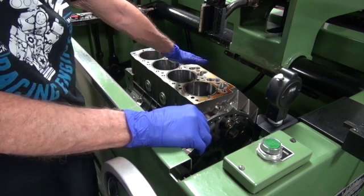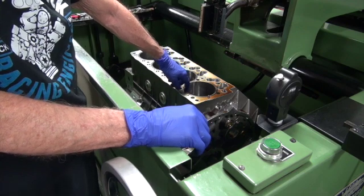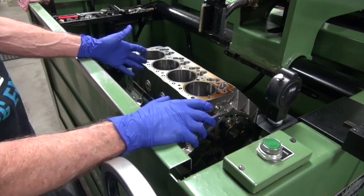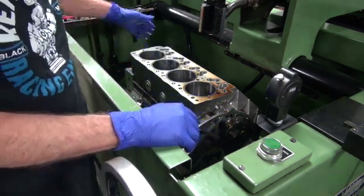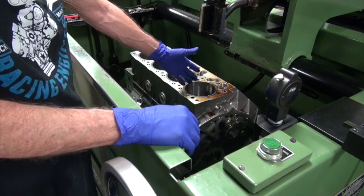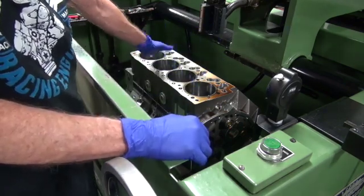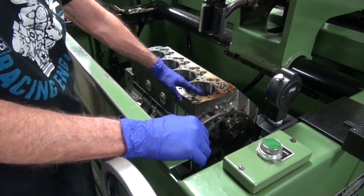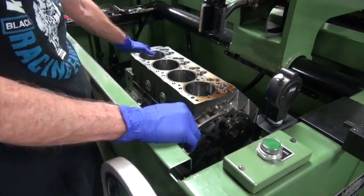There are other numbers now: RVK, RPK, RK, and RZ, and it's hard to hit all five at once. The last two blocks I did came out wonderful, but they weren't this same material. These are ductile iron sleeves, which is fine, but that's no guarantee it's going to behave like the last two blocks. So I have to practice out here where we've got all this metal to work with, and once I can hit the numbers, all I have to do is finish the block to size.